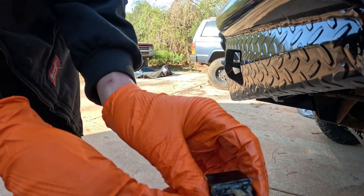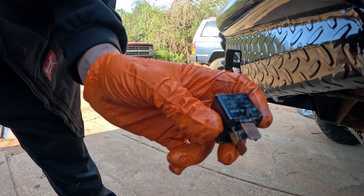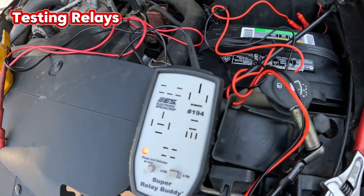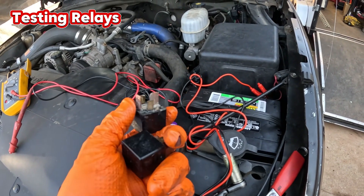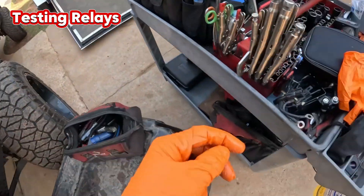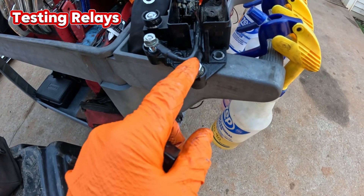This is a big four-pin relay — from what I've seen it's 100 amps, so gigantic. I was hoping to get these locally but nothing seems available. I bought this tool off Amazon — it's called a Super Relay Buddy by ES, and it wasn't that expensive. Both of these relays are big four-pins, and the more I'm learning, you have two relays: one for the glow plug and one for the intake air heater. When we did the testing on the controller, we had voltage on the air heater one but not on the glow plug one.